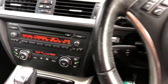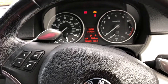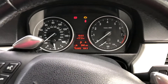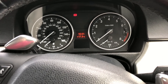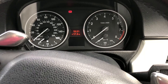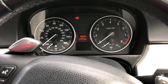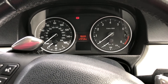On the quote list, they've quoted £143 for the drop link, which is reasonable, and £180 for what's called an FRM module — they didn't tell me that name, but £180 is what they've quoted to sort this error out. I spoke to my friend and apparently all it needs is a reset that can be done on diagnostic equipment. The machine he's got is an Autologic, so I'm going to try this. That's probably what the £180 charge would have been for — just plugging it into a machine and doing a reset.